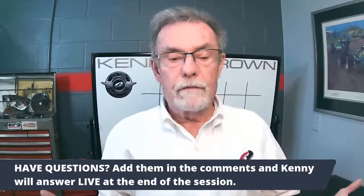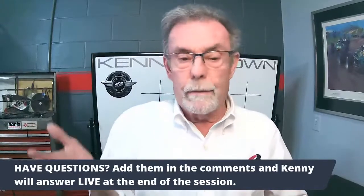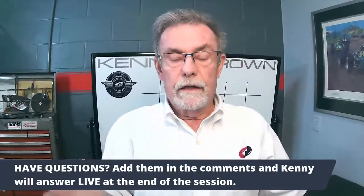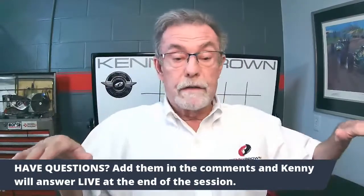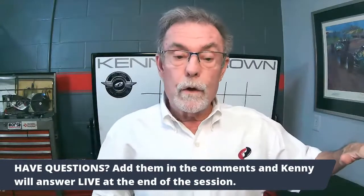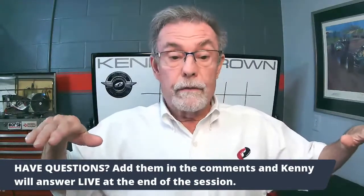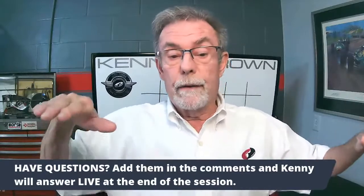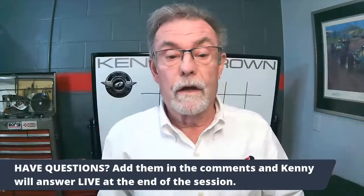All you have to do is think about it. You've got loads coming into one strut tower. And if you put a brace, doesn't have to be 3-point, just 2-point, side to side, having a brace on there is going to help transfer some of that load over to the other side and keep that from loading up and moving so much. So absolutely.